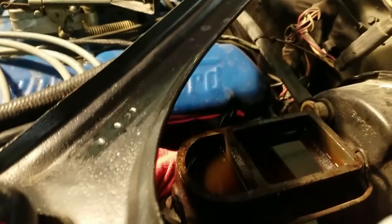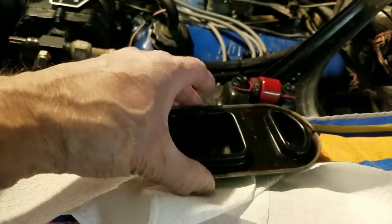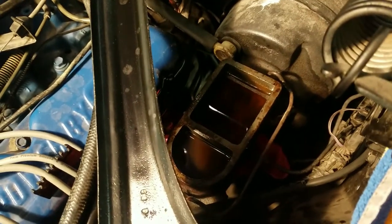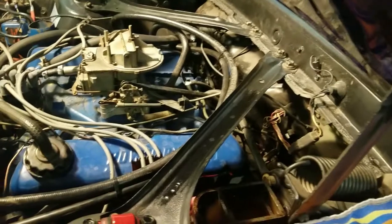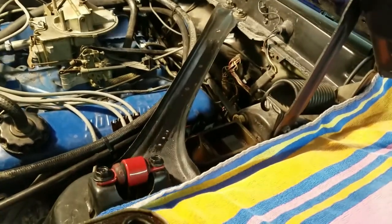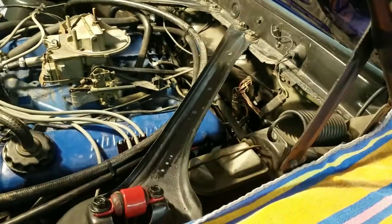Now, before you start bleeding the brakes, you have to take the cap off the reservoir here. This is basically the cap. As you pump it, the level in this will go down considerably, so you have to check it every once in a while or have your assistant help you check it. The cap simply flips on there, and then there's a wire snap that holds it.